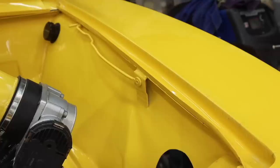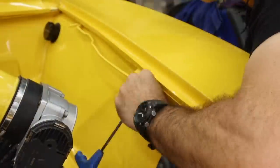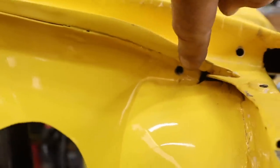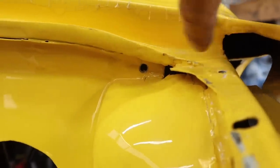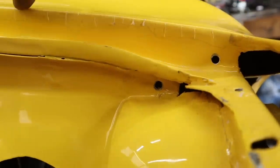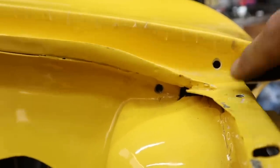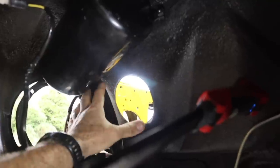I've got one bolt sort of hidden underneath the bonnet check strap, and the other bolt hole needs to be there — but I measured it inside, got the two shapes confused, and actually drilled it in the wrong spot first. That's not a huge issue; I can just plug it up. It's annoying when you drill where you don't need to. But it's a nice secure mount for the vacuum tank — I've got room for my headlight and room for my air filter, so that's looking good.